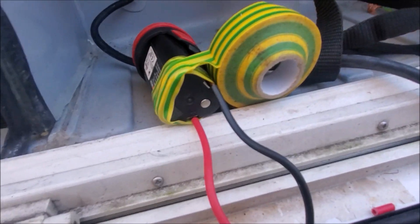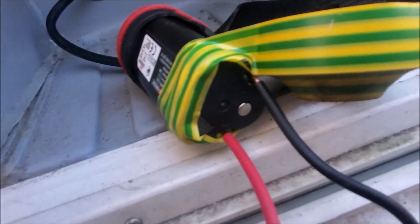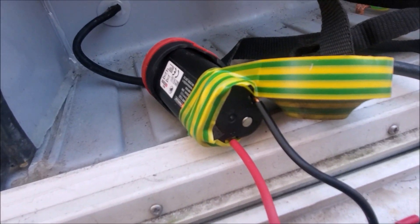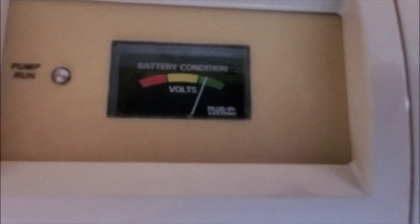There's the 12-volt battery - power tools are all 12-volt. They've even marked the battery plus and minus. An ideal way of doing this permanently, instead of sticky tape, would be to buy another charger, strip out the inside, glue the charger in, and just slot the battery in. All I run in this caravan is two lights and the sparker for the cooker. That battery side of the box hasn't been charged, so I'm going to charge it and see what happens.